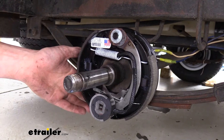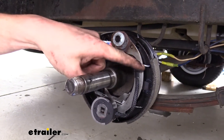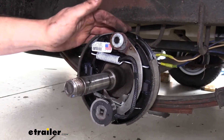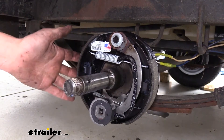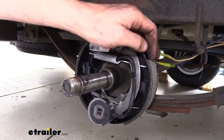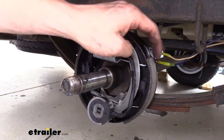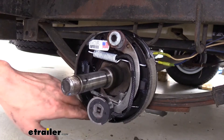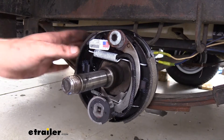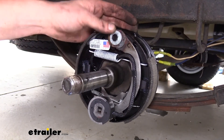This is what our brakes look like when they're installed. We just installed the passenger side, because they do vary depending on how the arms are and how the pads need to apply. We have what's called a leading-trailing setup here. Our leading pad is our smaller pad, and it has a little bit different friction property than our trailing one. It grabs a little bit harder and actually forces the larger surface area pad into the drum to do most of the stopping work. So it is important you've got the correct one installed on the correct side to get proper braking.